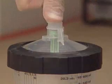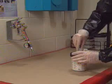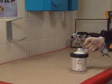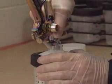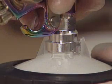If the paint needs to be shaken, the 3M PPS Shaker Core is used to protect the mixing cup while it's clamped in the shaker. The lid can be sealed with a cap, or if the paint is going to be used immediately, the mixing cup is fitted to your spray gun. With the mixing cup upright, the gun is inverted to fit over the lid and locked in place with a simple half turn, making sure that the lid fingers fully engage the adapter.